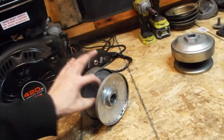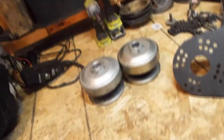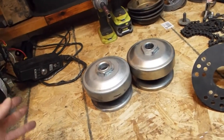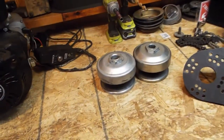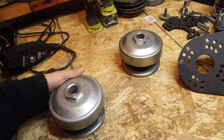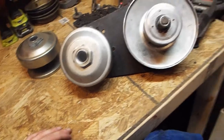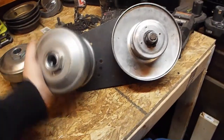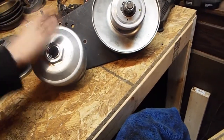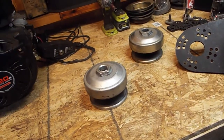There are some little cam rollers in here that slide on a little rail, and the cam rollers are getting jammed up. The best way to eliminate this is to take them apart, clean everything, put some new graphite on there, and put it all back together. We're going to show you how to take apart these 40 series torque converter driver pulleys, clean them, and put them back together. To remember driver versus driven pulley: the motor is driving the driver pulley, and the driven pulley is being pulled by it.